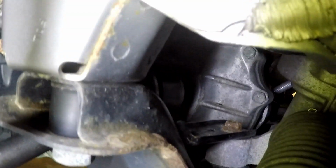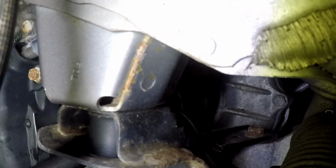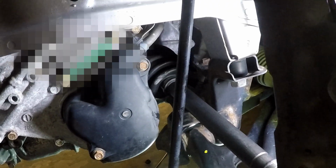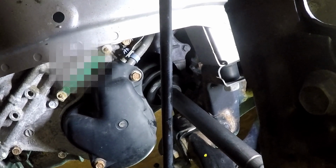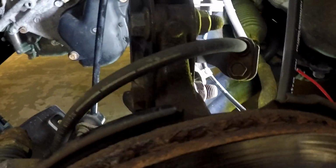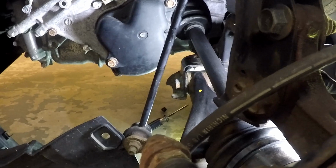I'm going to pause the camera here, and if I can't get this to seat in this direction, I'll pull it out a little bit, rotate it, and try again, with a bunch of iterations of that to get this thing in there. All right, well, that worked beautifully. I just pulled it out a little bit, and you can feel resistance when the little spring pin gets in the way. So I used a little piece of shot line to pull this out of my way a little bit, so I could line the CV axle straight above the brake line. Pulled it out, turned it a little bit, gave it a sharp push like the tech manual said. That didn't work.